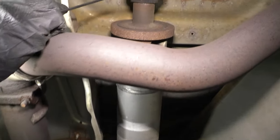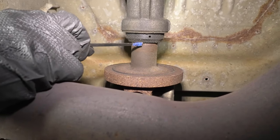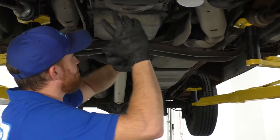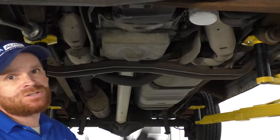Moving towards the rear of the transmission, you're going to see the tail shaft seal located right here — that's where the drive shaft goes in. If the seal is leaking, you're going to see fluid coming out all down along here and even through this little weep hole, probably making a mess and dripping onto your exhaust. For fixes, locate the leak. If it's a big old mess, clean it down the best you can, check your fluid level, top it off, and then take it for a road test — drive maybe a couple hundred miles. Bring it back and look — at that point you should see a pretty apparent transmission fluid leak. Transmission fluid is a chemical, so if you get it on your hands or in your eyes, it's going to be a major issue. Make sure you have hand and eye protection.